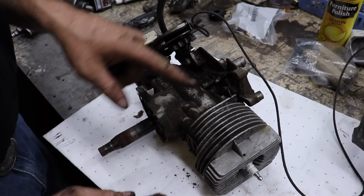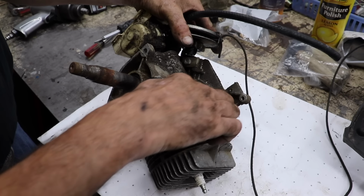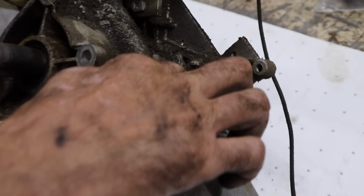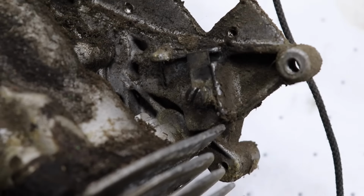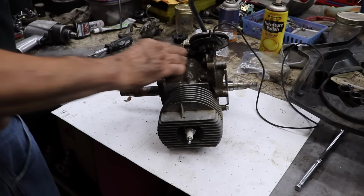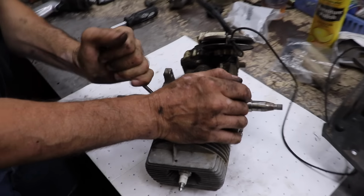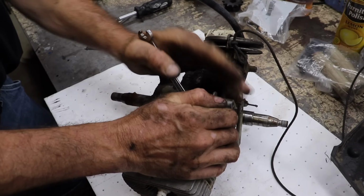So now here's that little screw. Remember I was telling you? With this little metal tab that we had to use the offset screwdriver on. There it is, up underneath there. So now I'm gonna remove these four cylinder bolts, and we're gonna pull the cylinder off the piston. Those look to be like 3/8. Yeah, and then we're gonna see if we got some stuck rings,